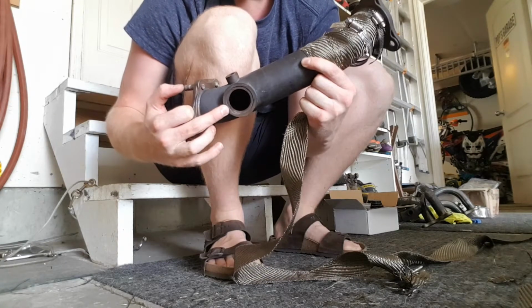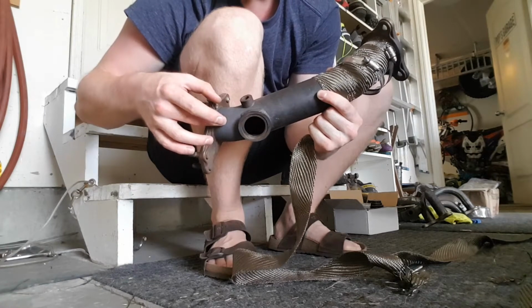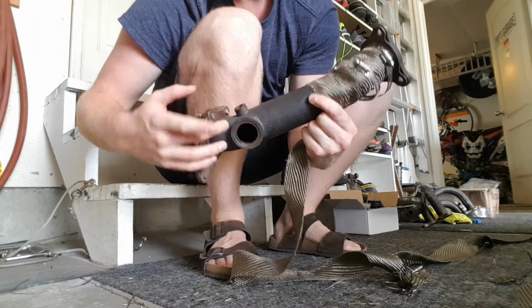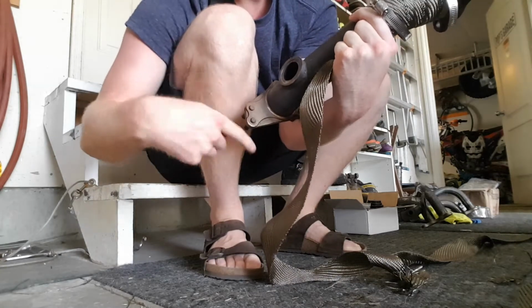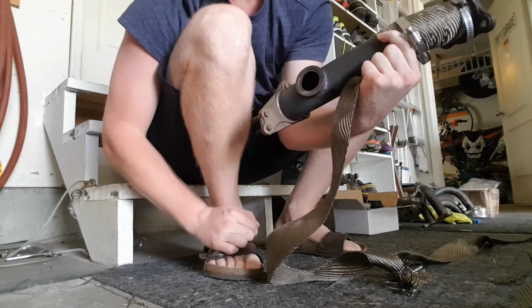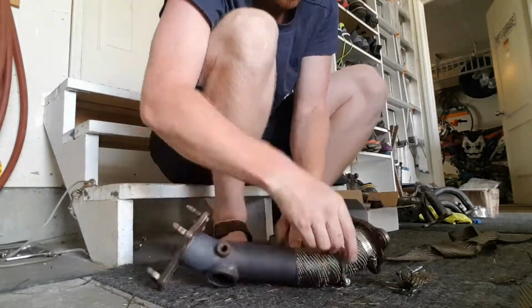I'm actually going to end up likely running a piece of wrap just horizontally, just along the up pipe, probably between the bung and then on the other side as well. That's where you'll likely get some gaps when you're trying to wrap around them. So by putting a little strip along the side of the pipe, it'll allow you to make sure the whole up pipe is actually covered.